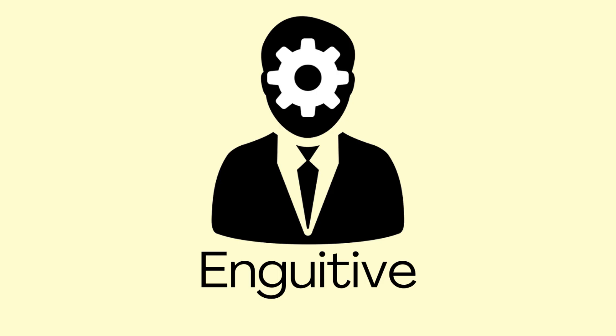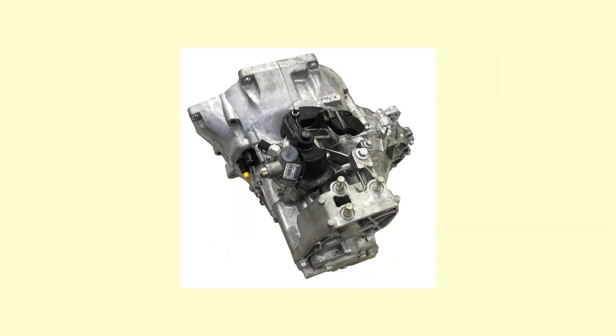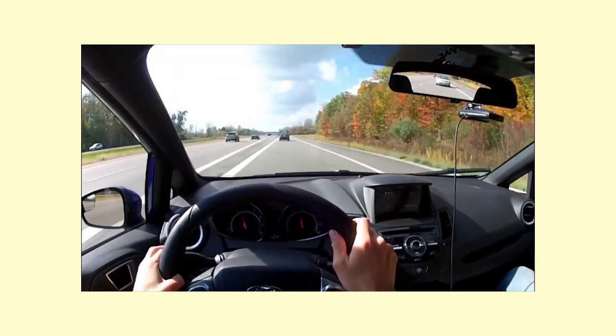As mentioned early in this video, there's only one type of transmission that comes with this car, and luckily it's the right one: a six-speed DuraShift B6 manual, which features Ford's torque vectoring control system to brake the inside front wheel to aid agility. At first glance, first and second gear look quite long, but as the final drive ratio is actually very short at 3.82, this makes first gear very short and the other gears are spaced pretty close to each other. The sixth gear is long to cruise at decently low rpm, but not too long so acceleration feels dead.